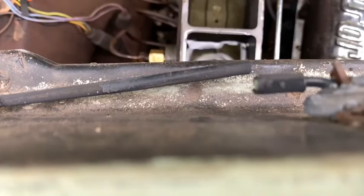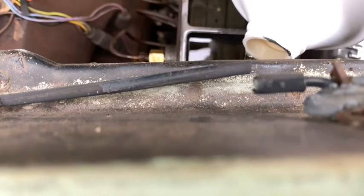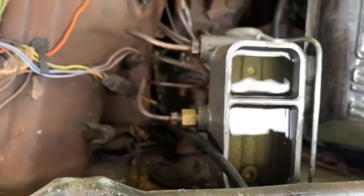Let's see what we got now. Getting pressure, not hearing anything. I gotta fill up that front reservoir. Getting low though, they're both getting low. Means there's fluid going somewhere. I got a little bit of a pedal, very spongy. Not hearing the other side squirt anything.